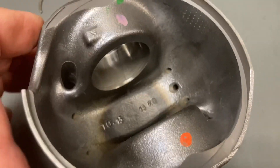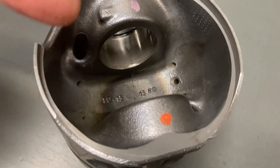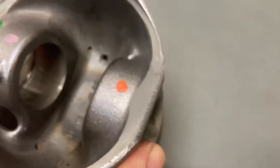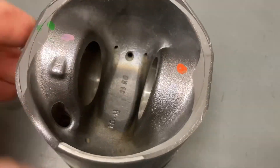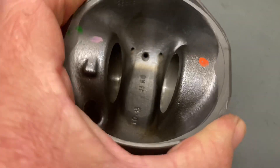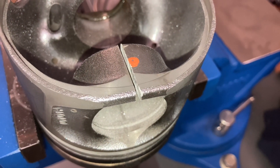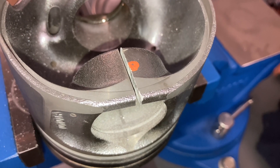So what we're going to do for this piston — I thought it would be interesting to cut it this way so then you can see through it that way. Because obviously it seems like it's cracked through the whole thing — I haven't bothered cutting a piston in half before — I'm just going to cut the rest of the way through these. I've got a 115mm grinder with a flat blade on it.